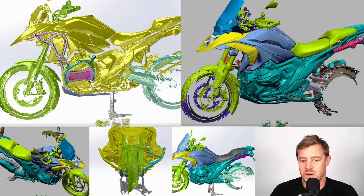At the end of the scanning process we have a pretty good model of all the fixation points and base dimensions we need to build on. In the top right corner you can see the bike split into colors — each color is a different part. For example, the fairing was removed, scanned behind it, then scanned with the fairing and meshed together. This is super important to figure out where to attach parts.